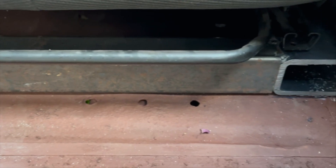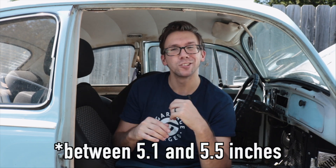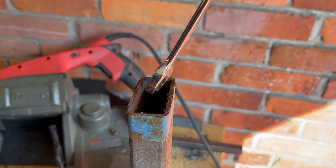There are a couple different things I like to keep in mind when building seat brackets. If I need to raise the seat up a substantial bit, you want to think about whether you're going to have the bolts go all the way through the floor — nut and bolt, or weld to the floor. There's nothing wrong with either approach until you start approaching the national average of bolt size length, but make sure you can fit a ratchet or wrench in there to actually tighten down the nut.